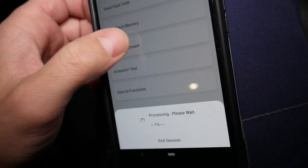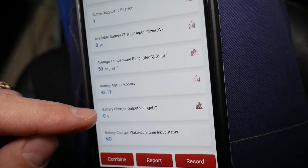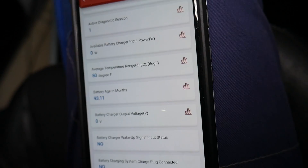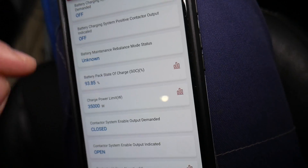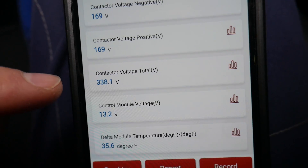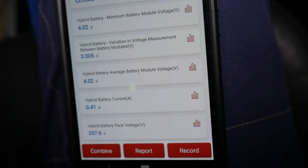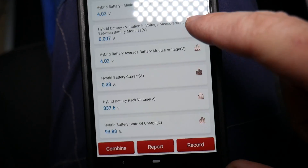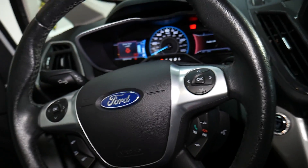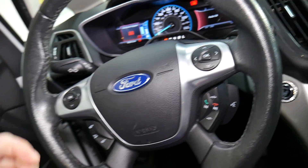You can also go to 'Read Data Stream,' which opens all the parameters for the battery. You can check multiple things: how old the battery is, how many diagnostic sessions it has had, errors, state of charge, voltage, and temperature sensors inside the battery. You can also check hybrid battery current deviations — we can see a deviation of 0.065% between the cells, which is not bad at all. As long as it's less than one percent, I wouldn't be concerned. That's how you test it, guys. Hopefully the video is helpful — thank you for watching, see you next time.